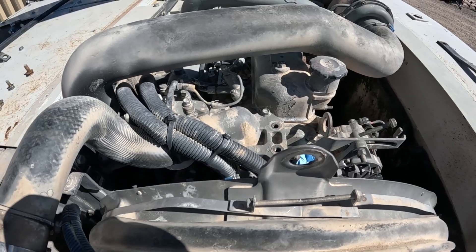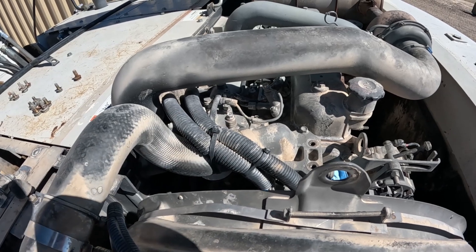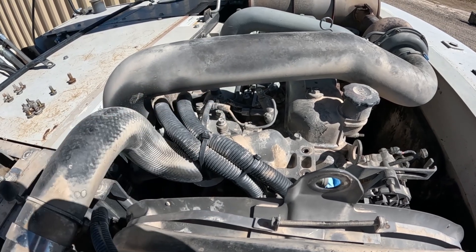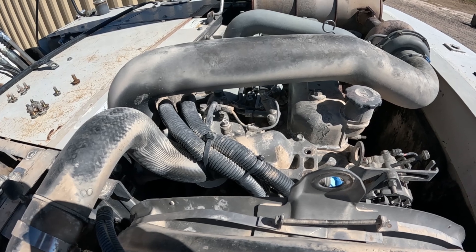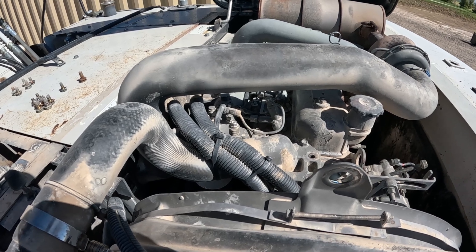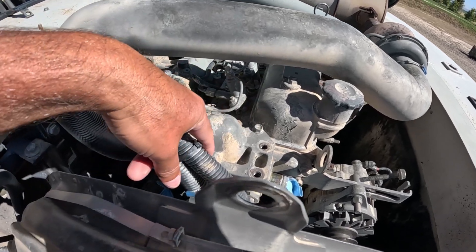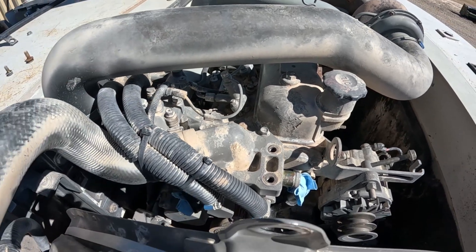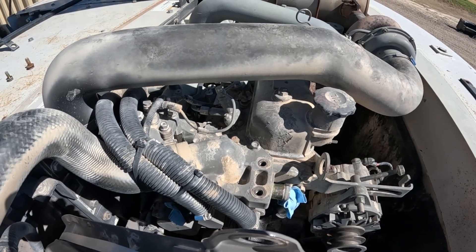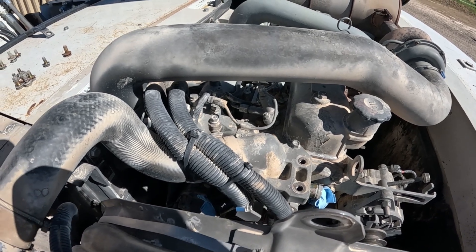What I'll have to do is pull this radiator hose. These clamps I put on — I like them better than the factory ones. The factory ones have a 7mm head; these have a 10, so they're a little bigger. I'll get that pulled off. Apparently I've zip-tied this at some point — that's not factory — so I'll clip those zip ties. Then there are three bolts: one here, one here, and one back here, and those are 12mm. That's all it should take to pull that housing off.